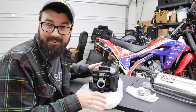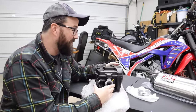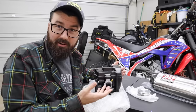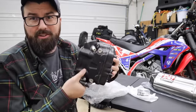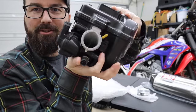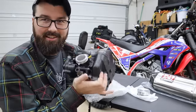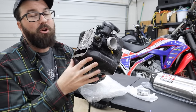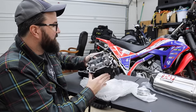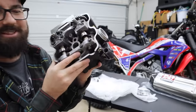Let's talk about this black cylinder head. This came off one of Ari's race engines and it's a fully ported head. It comes off the CBR but it'll bolt right on — it's all the same. The intake side is really noticeable. When we pull the other head off and have them side by side, I'll shine a light in there and we'll really check them out. It's been nicely opened up and re-cleaned. Look inside — it's so clean in here. He even wrote the valve clearances down right there.